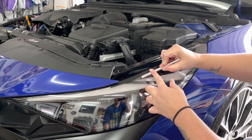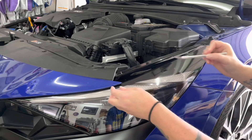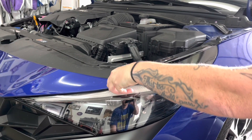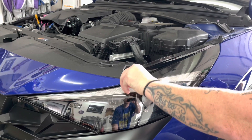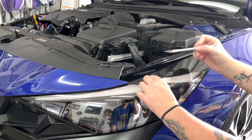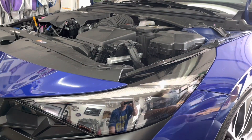The third cut will be done on the headlight itself. You do not need to press hard to cut the vinyl. The cut will need to be tapered from the front bumper to the daytime running light. After you've finished your cuts, go over the cut areas with a squeegee and make sure to tuck the vinyl in between the headlight and wheel arch.